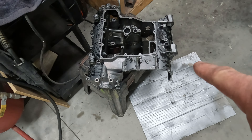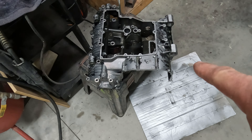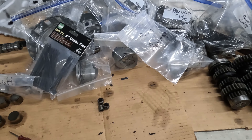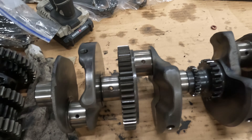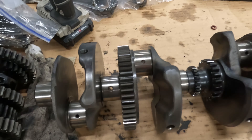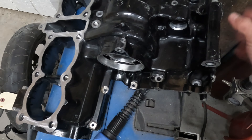The engine was pristine. The main bearings look like they'd hardly had any use. If you're familiar with main bearings — journal bearings — usually if they're worn they show a copper look or a lot of polishing. These main bearings look really good; you can still see the satin finish on the coating. The crank has no flaws and is in excellent shape. I got it all cleaned up. I did have a really gnarly trouble with one particular bolt.